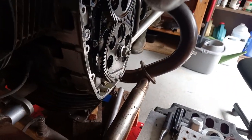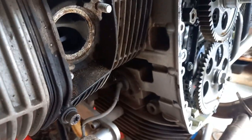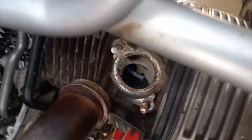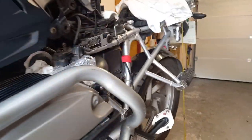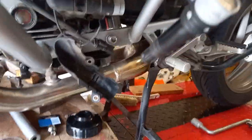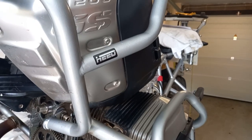You don't have to mess around with the rest of the crash bars. You'll also need to drop the exhaust system down, so the studs here — while you're about it, new crush gaskets are a good idea, otherwise you'll have popping and banging if you reuse the old gaskets. New ones aren't very expensive. It also meant removing the silencer and jiggling the exhaust system around so it dropped down out of the way. Also, taking out the spark plugs — the bottom ones as well — so you can turn the engine over with no compression, which makes things a lot easier.